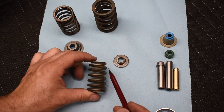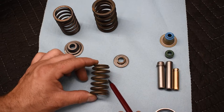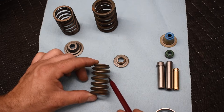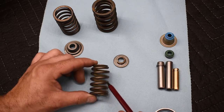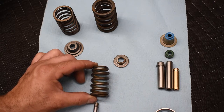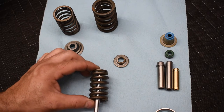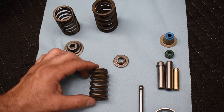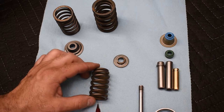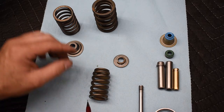The conical or beehive spring has a lot of benefits that come down to efficiency. The whole challenge for valve springs is to close the valve, and this has to happen at higher RPM. If they want the engine to rev higher, or if a supercharger or turbocharger is added, the valve spring has to pull the valve closed more forcefully. The spring gets compressed as the valve opens, and the spring's job is to pull it back up.